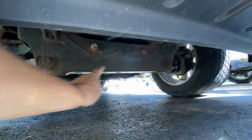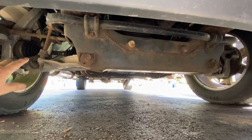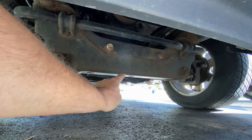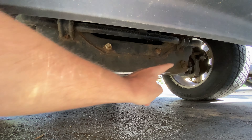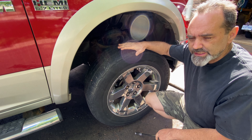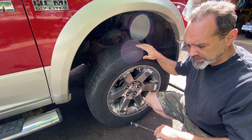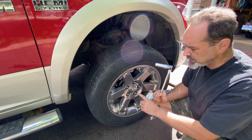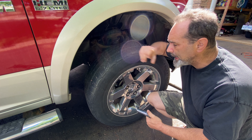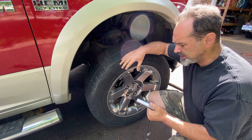So that's why we're doing this today. I don't have the parts yet — waiting for the delivery truck — but we can at least start stripping the front end down. First thing we need to do is jack up the truck and remove the front wheels. When jacking it up, I'm going to use the front cross member. Do not jack it up on the side sections because you need the wheels to hang down to get the springs and shocks off. I'm going to jack up right in the middle, with axle stands on each side.